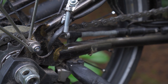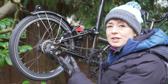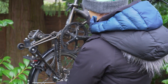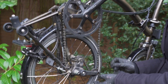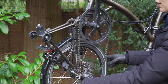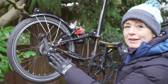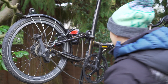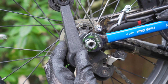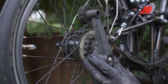One of the benefits is we can get rid of the whole derailleur gear setup, which will make the bike look a bit sleeker. Top tip: to remove the chain tensioner, remove the tension from it first before you remove it. Simply drop the back end, take the chain tensioner off of the chain, and then you can unfold your bicycle again. When you remove your chain tensioner it shouldn't fly off into the far distance. To remove the chain tensioner nut I will need a 15mm spanner. Now we're just going to remove the chain tensioner — it really should just wiggle off.